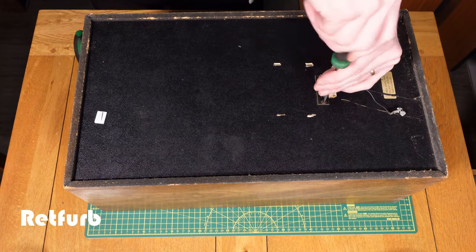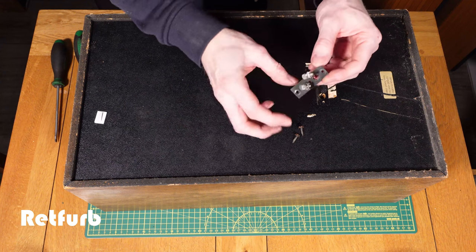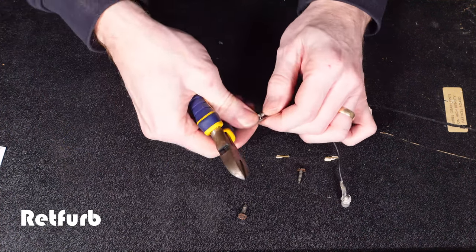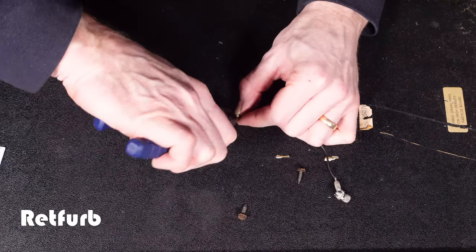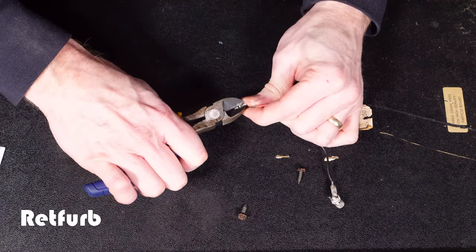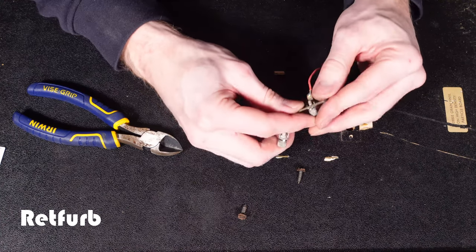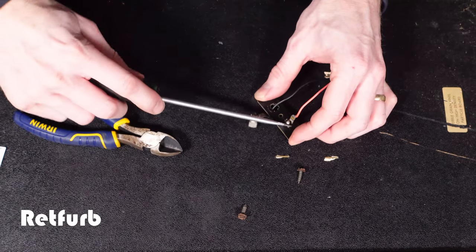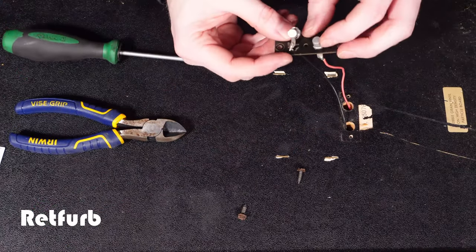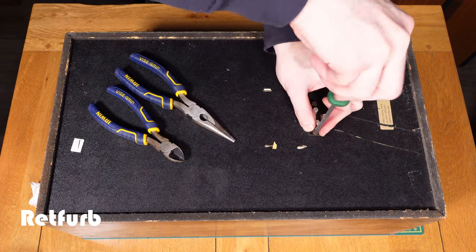The first repair is this small bracket on the back. These little connections should be sitting in the bracket on the back of the box and not hanging out — they've just been pulled out at some point. I'm going to bend back the small tabs on the back of them, locate it back into the little plastic trim, and then screw it back into the box. Just going over with the pliers and bending those little tabs back straight, pushing them into the trim and bending them over. They're not a strong design so any pulling with the cable tends to pull them out. I've done the other side exactly the same and now screwing it back into place.